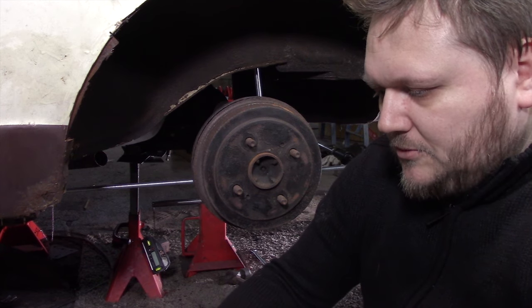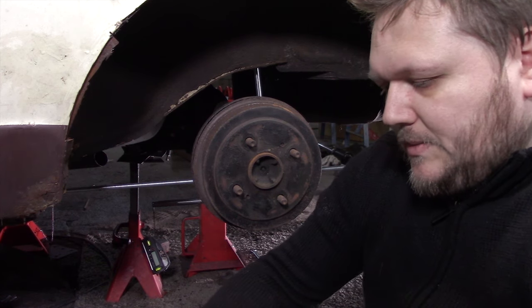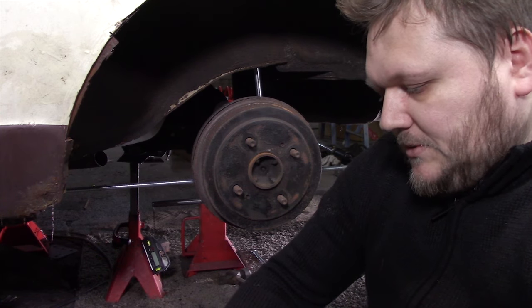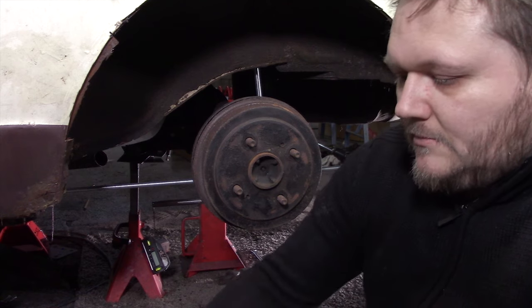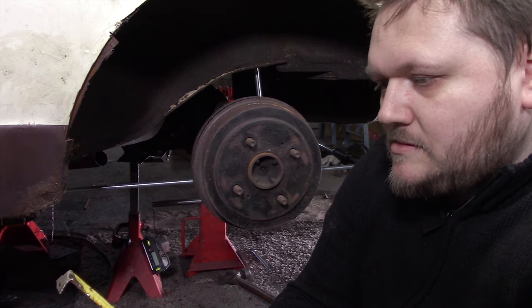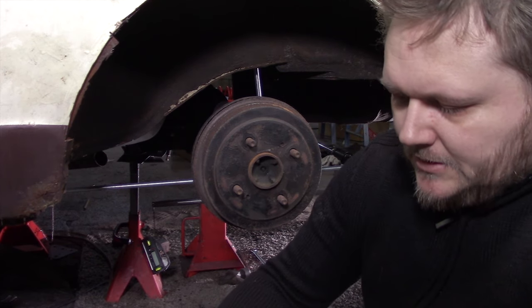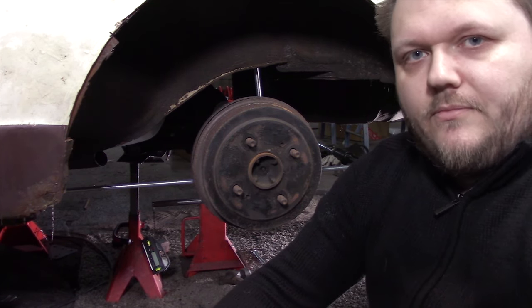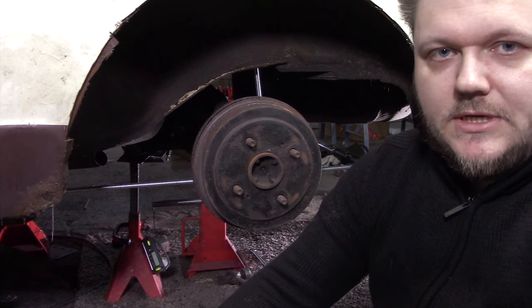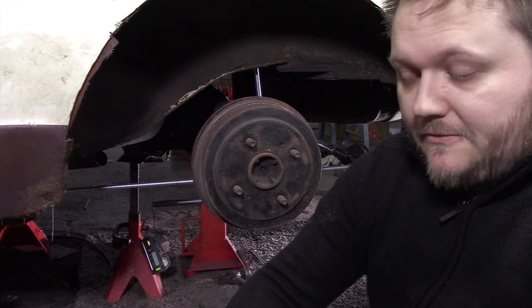So I'm going to set them up in the center. So we have about 1 centimeter, something like this. And now I can measure the difference: it is 6.5. So it is 6.5 plus 6.5, that is 13. So 48 minus 13, that has to be our tube length.